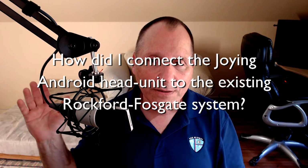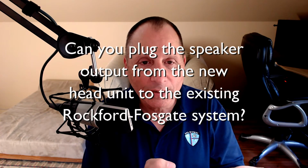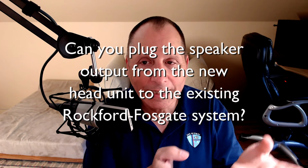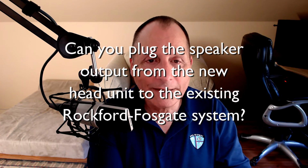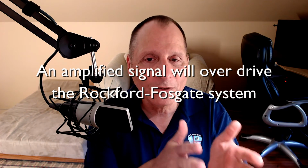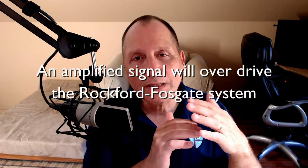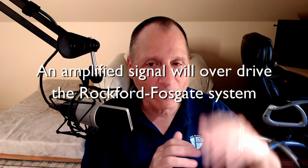That was fine. So here's probably what most of the people are wondering: how did I connect the Joying head unit to the existing Rockford Fosgate amplifier and speakers? The first thing folks have asked me is, couldn't you just take the speaker outputs from the new head unit and connect them to the wiring harness to drive the Rockford Fosgate amplifier? The answer is no. If you take the amplified speaker outputs from the Joying head unit, it's too much. Little tiny volume adjustments could cause the volume inside the cab to go up dramatically.